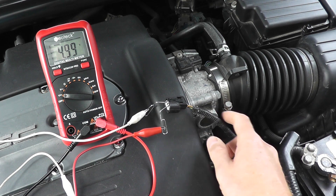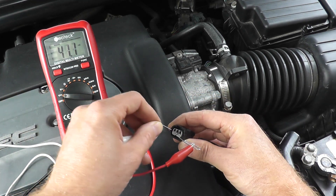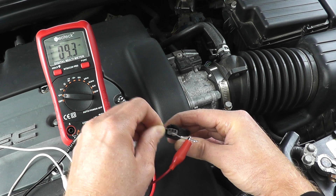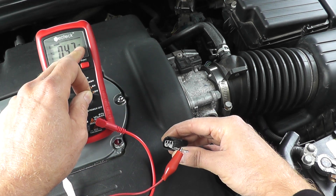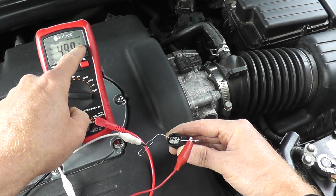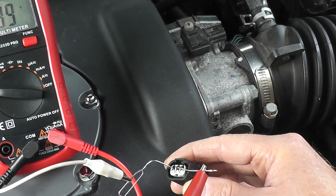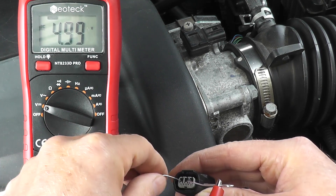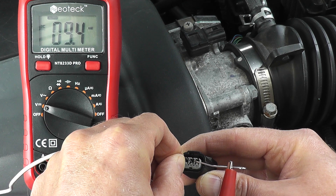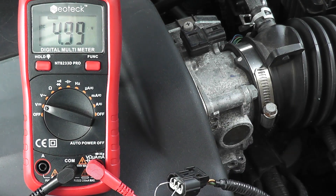The wiring on modern vehicles tends to be quite good. But if you're not sure which wires to touch, you can trial and error it. If I remove this lead, the reading goes away. Touch the middle one and you get nothing — the multimeter is reading only millivolts, a very, very small amount of power. But once we touch the right one, it's a proper volts reading. So you can do a trial and error; you just want to see five volts of power.